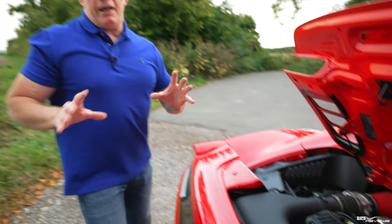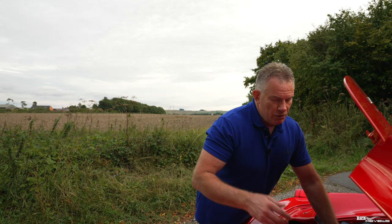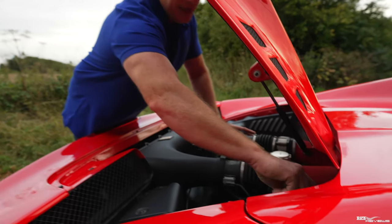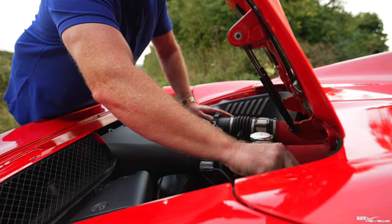And the antifreeze you have to have mixed in to prevent the water from freezing during the winter periods, but also, as a massive, massive priority, you use antifreeze because it has anti-corrosive capabilities as well, because these engines are made of various different metals, in effect aluminium, and you have to make sure that the aluminium doesn't corrode. And putting in a correct additive, which is the antifreeze, with the water makes sure that it doesn't corrode.